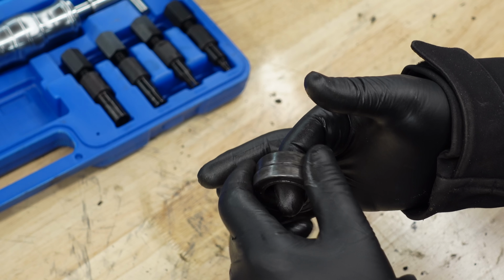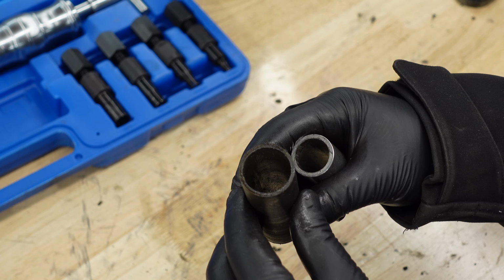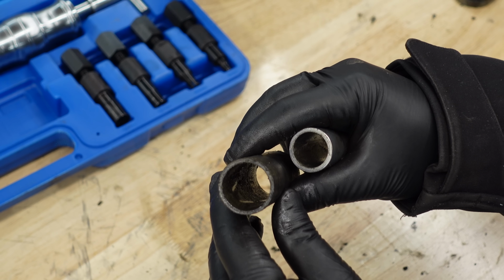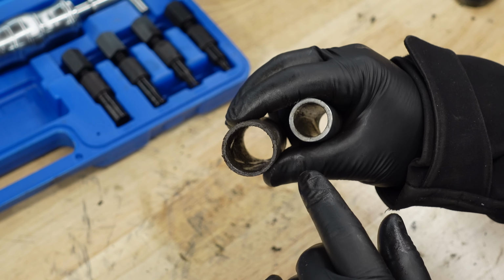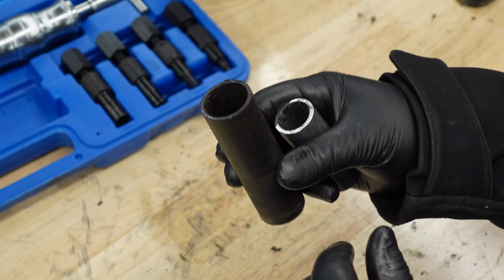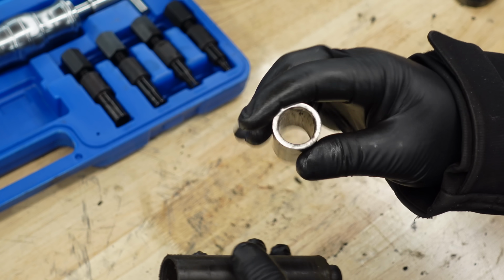This is what will get your axle stuck. Twice a year, take your rear wheel off, take your front wheel off, clean the axle. I've had too many bikes in this shop that have seized axles. They turn one tire change into an hour and a half ordeal just because I had to get the axles out. And with that, that wraps up part three of this video series.